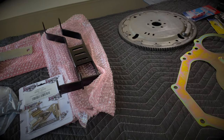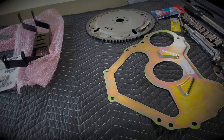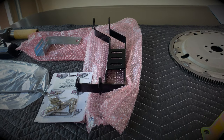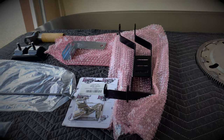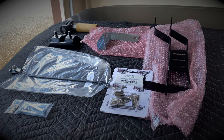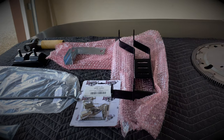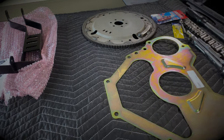That's because in the F-series trucks they use the wheel speed sensor. There are a couple different ways to tackle this issue — we could source a new tail housing, or we can drill the hole in the provision. Because I did remove the tail housing and the gear on the output shaft for the speedometer gear is there, we're going to go ahead and drill out that hole in that provision, and then drill and tap a hole for the retainer clip as well.